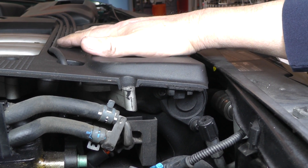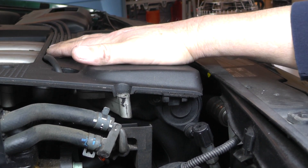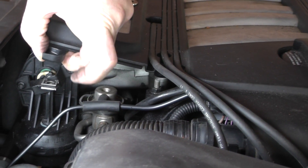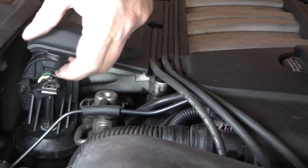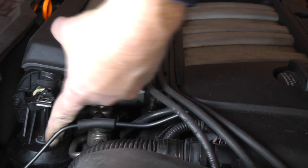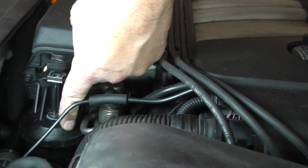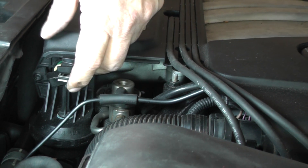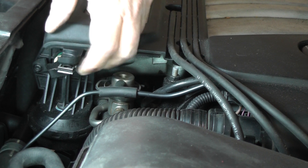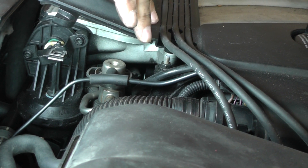Just keep in mind you don't have to, but I'm going to do this so you can get a better shot of what I'm doing. On the other end, we're looking at the other end of this valve inside the upper plenum. You can see right here this is the end of it — it's attached to a linkage to this rotary valve down here. It's vacuum actuated. If you want to see how that looks, you can go back to the secondary air injection video series, which shows how to check it and what the purpose of it is.